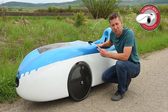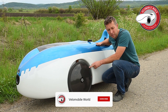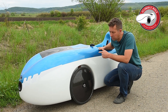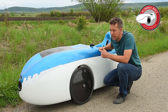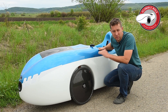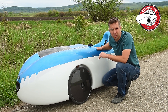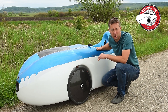So before I make this test I check three things. First one is are my brakes completely loose. The second is tire pressure — I check if there is good pressure. I drive mostly here with six bar because the roads are pretty rough and I don't like having a very bumpy ride. I know six is not ideal for rolling resistance, but if I put left and right both six bar it doesn't matter.